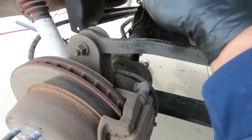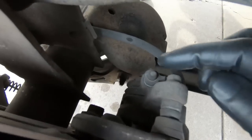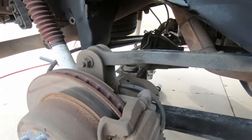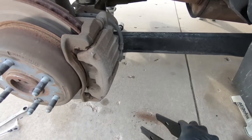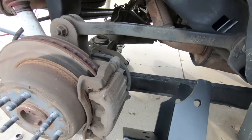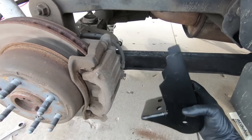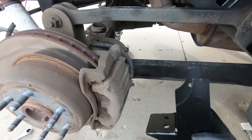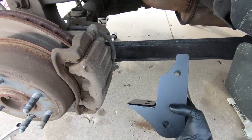Now that we have the springs out, I did lift the rear end a little bit just to give me some more access. I need to take out the 21 millimeter that holds this bottom trailing arm in place. The reason we're having to do this is we are going to put, basically this is an extension, because when you get it low, the angles on these are out of whack. So this DJM kit, which I'll list in the description, basically puts it back into alignment because of the length, or basically the amount that we're lowering it. So I do recommend this anytime you go 4 inches or more, which is what we are going to be doing.